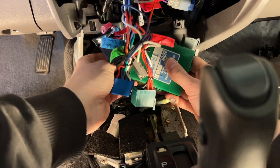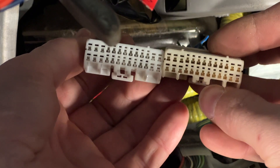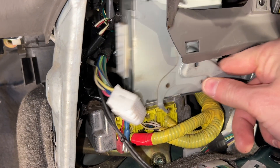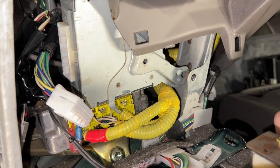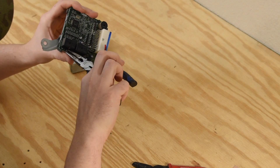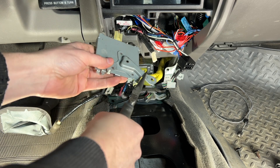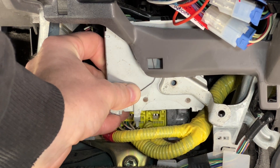It's now time to move on to mounting the controller. The Tacoma's four-wheel drive controller is located under the lower trim panel, held in by a single bolt. Here you can see the size differences between the two controllers. Although my research showed that the connectors would be the same, it was nice to physically verify — this means the Tacoma's harness will plug right into the 4Runner's controller. To simplify the wiring later, I'll mount this controller in roughly the same spot as the Tacoma's controller. I mocked up a few ways to mount it and I like this location and orientation.